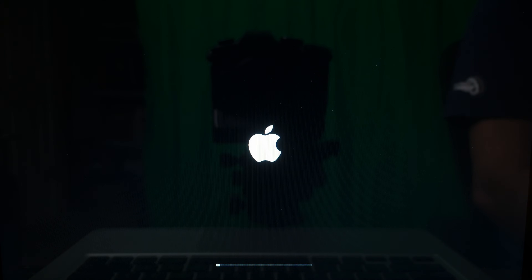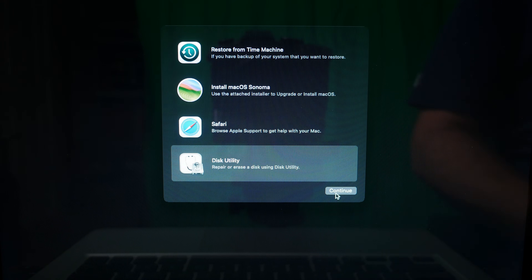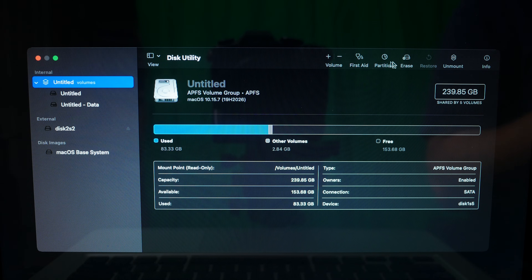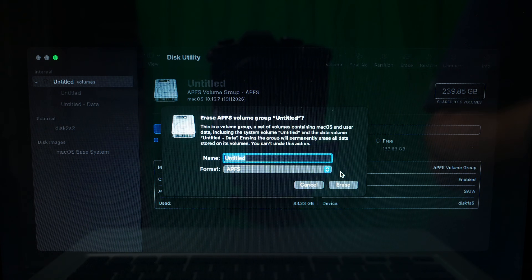Here we are at the installer menu and I'm going to go down to Disk Utility. What I'm doing here is wiping out this drive and installing macOS on it. If you want to install on a different drive, you just need to open up the back of your MacBook, take out the existing drive, and put the new one in. I'm just going to go all in and wipe this out. Select the internal drive, go to Erase — make sure you have your internal drive selected, not another drive you don't intend to wipe. I'll change the name to something like 'macOS,' leave it APFS, and erase.